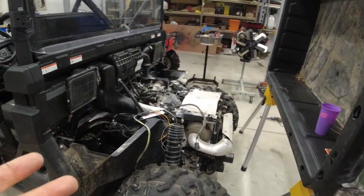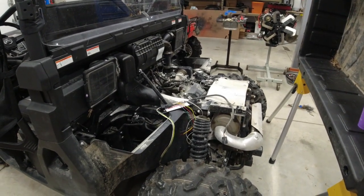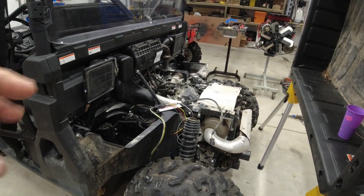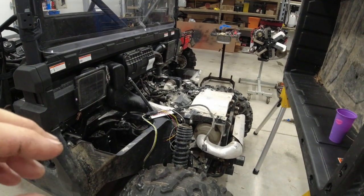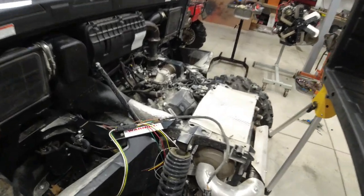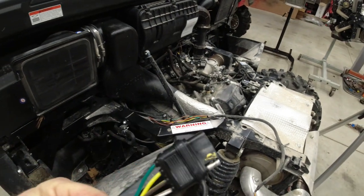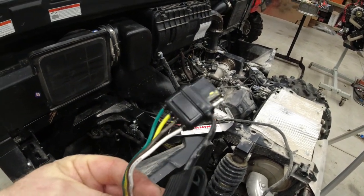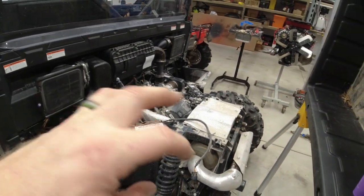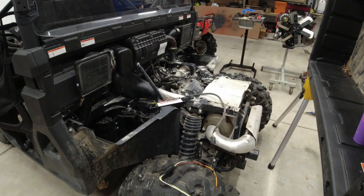And it's the same if you had a truck. Say you had a late 90s Chevy 1500 truck where you had a brake light and a turn signal lamp. You can't just tap in a 4-flat trailer plug like what this has on the end of it. One of those, you can't just tap that in. You have to have a converter that takes those two separate signals and combines them to be able to use one light, like a trailer.